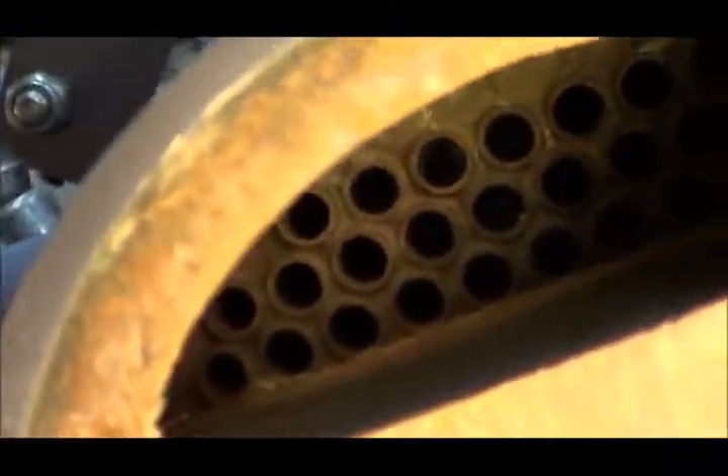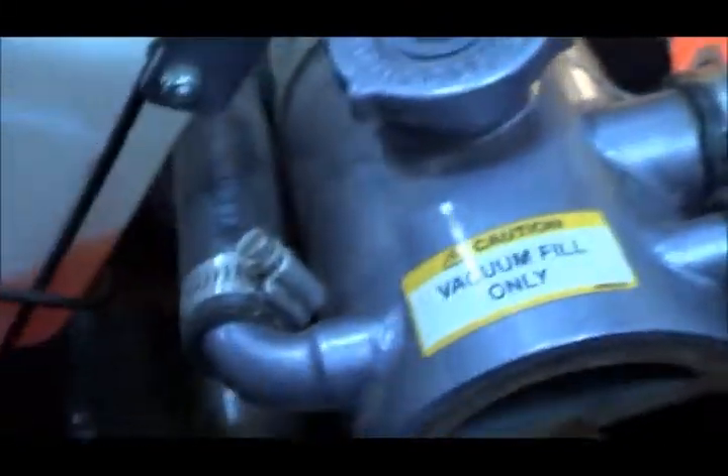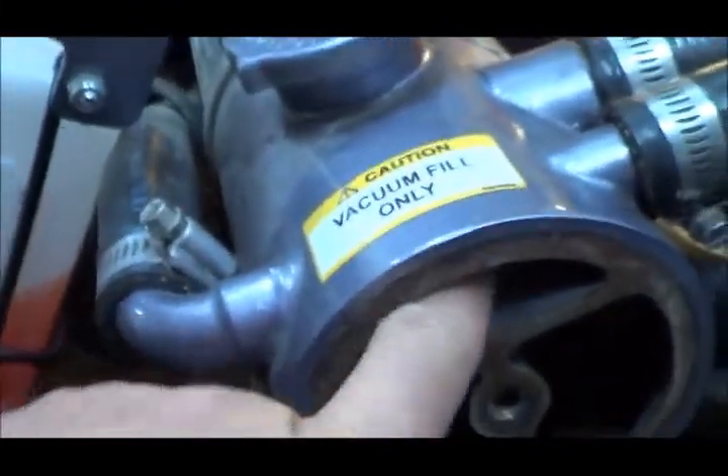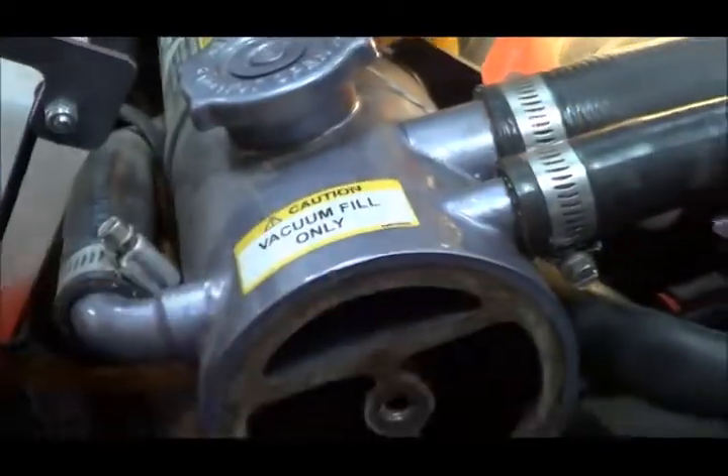Here we're looking at the top three rows. The water comes in there and then it heads out through these hoses. From this top compartment it heads out to the exhaust. So that's how it works — this is a three-pass cooler on the river water side. The river water makes three passes through those tubes, and that has some interesting implications.